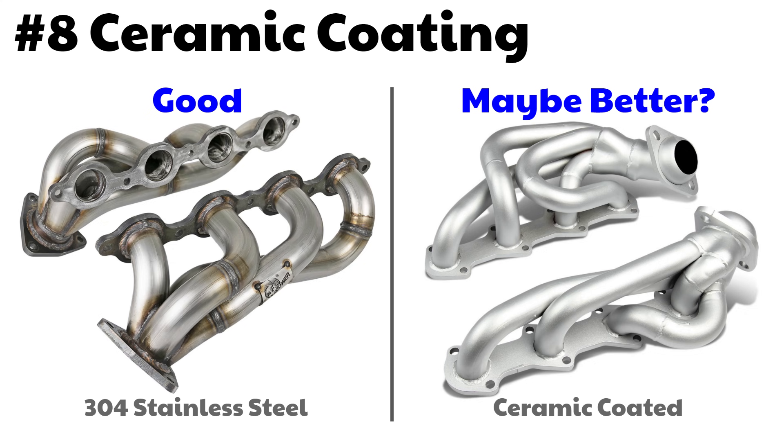For me personally, I have three problems with ceramic-coated headers. First is the price — it's $350 to $500 to have a set of V8 headers ceramic coated, and you're getting maybe zero horsepower gain. Second, I personally love the look of raw 304 stainless steel, even as it corrodes a little bit. Third, my experience installing headers is that you usually have to clearance them, and if you hit ceramic-coated headers with a hammer or make other adjustments, you're going to ruin the finish. So I say get some good 304 stainless headers and leave them as is — they look beautiful even as they corrode.